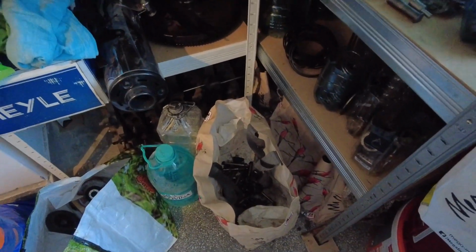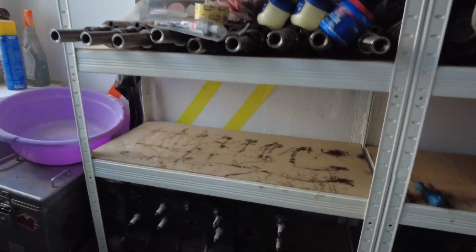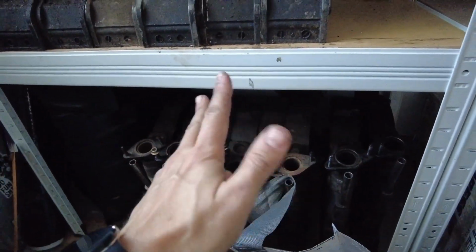I got a couple of bolts left to sort, but the sad part is that most of the irons are, let's say, unusable right now, and that means that they require resurfacing. Most of them need lapping and re-nitriding to get them up to par, and I'm just trying to piece together an engine to get the black RX-8 up and running.